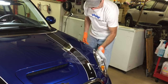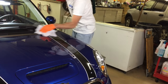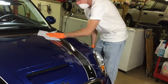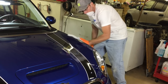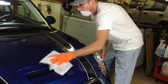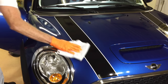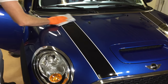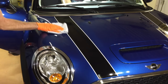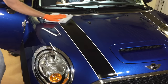Let's talk about the two-towel removal method. I have the first one that's marked — I'm going to use that to get most of the product off in one pass. I'm going to use the second one to get any product that has been pushed to panels I haven't treated yet; I don't want any high spots. They dry dark, no matter what color you're applying to. So I go around, get all the surrounding parts, then go over the area I just treated and mop that to perfection. Starting off with the marked towel, quickly flipping over to the secondary towel and finishing up.